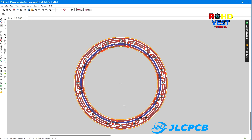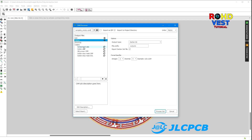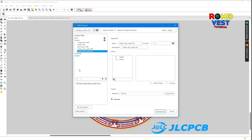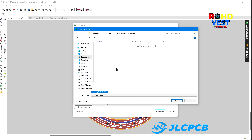Let's see how you can export the PCB schematic in gerber format and how you can upload the zip file on JLCPCB.com. Left click on the CAM processor, choose local CAM job and select gerber274x. Right click on each element of the legacy menu and select convert legacy section to new CAM format. Left click on the plus sign, choose new excellon output, select export as zip, press the process job button and choose the location where you want to save the zip file. Click the save button.